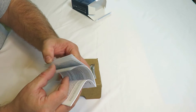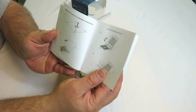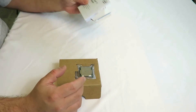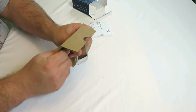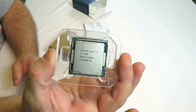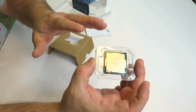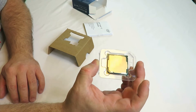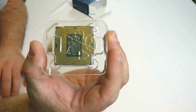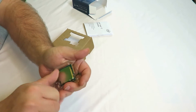This kind of stuff you need pictures or videos — but oh look, I do see some pictures! They're going to show you a generic picture on how to install it, which will be the same for everything. Don't worry about it though — I'm going to do a video for you. Now here we actually have the processor itself. Be careful when you take it out. The top is fine to touch, though you probably don't want to — the grease from your fingertips won't allow for proper application of thermal paste. On the back you definitely don't want to touch it at all, because those gold contacts have to make contact with the pins on the motherboard.